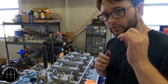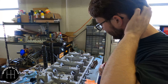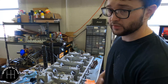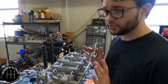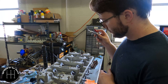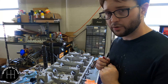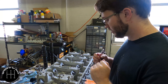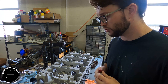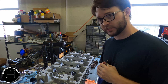But this was soda blasted, so it's good to go. If you have a head that's been media blasted and looks like this — the cam journal surfaces aren't polished — that's not a problem, that's 100% okay. The resurfaced deck surface is a different story, obviously, but for the cam journals, no problem. I wanted to share this because it is exceptionally valuable information and I'm sure it will save people a lot of money.